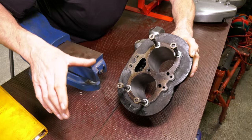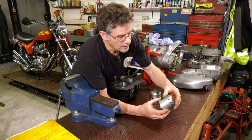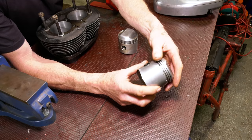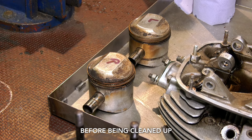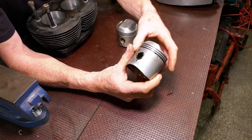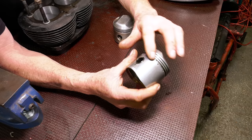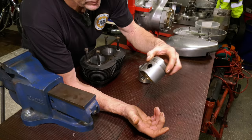When we put this together I'll show you that the bike will run as clean as anything. We're just going to put new rings in there. This is the right-hand piston and this is where it's cleaned up - it's a good serviceable piston. With new rings, that'd be fine. This is where we had the seizure. Now, if you were racing bikes in the paddock and you nipped up a bike, you would come in, whip the head off, the barrels off, clean it, and do exactly the same as I'm doing now - and that would be out in the next session for racing. I've just taken high spots off that. What's important is the lands where the rings run - these are the lands. If the ring is sitting there properly and you've got a decent bore, it won't be a problem.